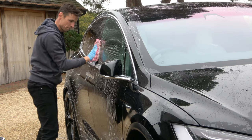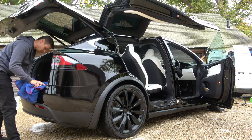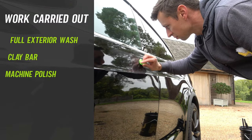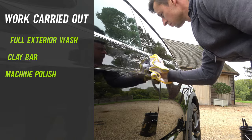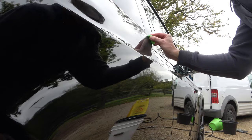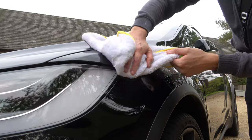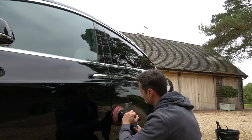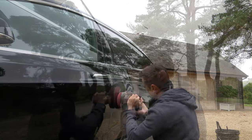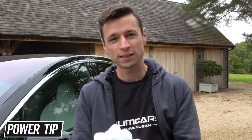I want to show you guys exactly how to get rid of those pesky streaks that you may find on darker colored paintwork. After I finished the clean, I followed up by giving it a clay bar followed by Meguiar's Ultimate Compound before applying the ceramic sealant. This gave me a better surface to work on. I'll jump in straight away and say I wasn't machine polishing this all day — I'm a mobile guy, I was under a tight schedule, fitting it within the client's budget. I just wanted to tidy up a little bit so the surface would be good to apply the product.